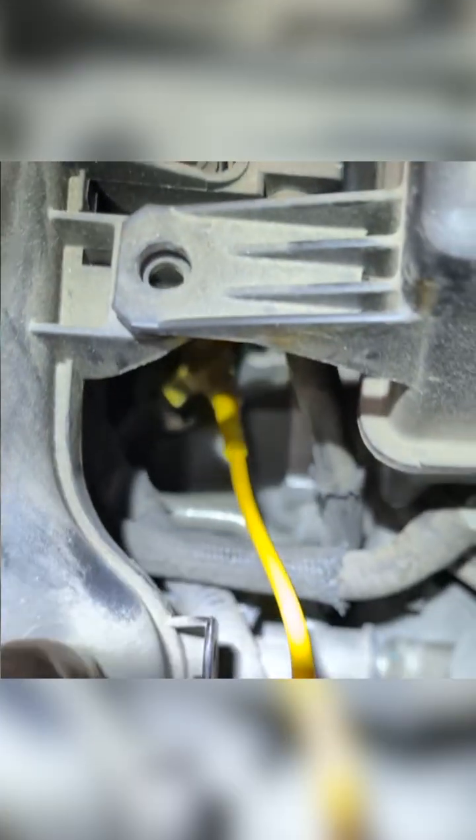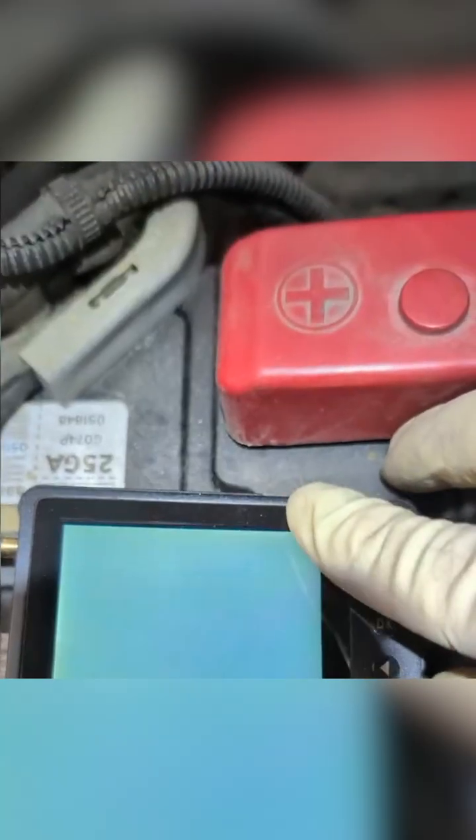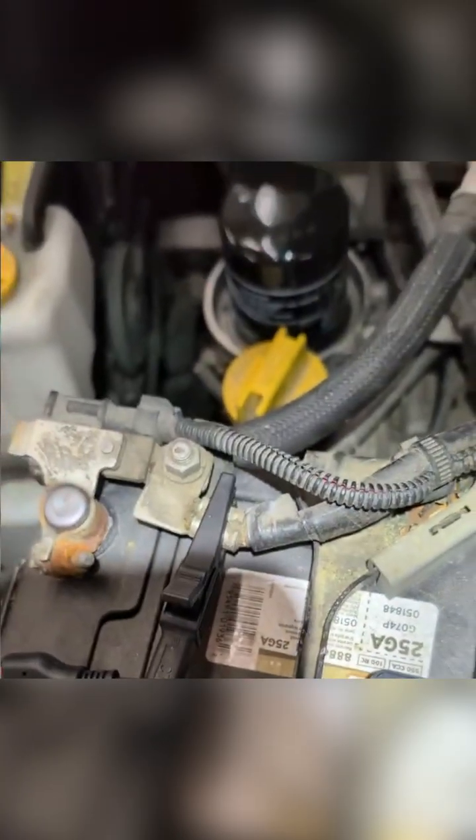As I went under here, there's our crankshaft position sensor right there. You can see I've got my T-pin and the pink wire and my meter grabbed on. So let's just turn on the scope. We've got our negative to ground.